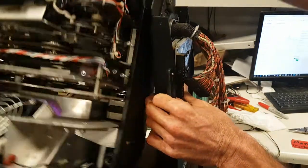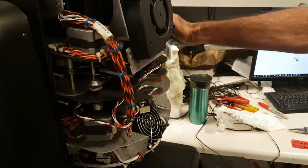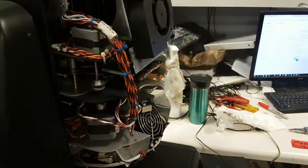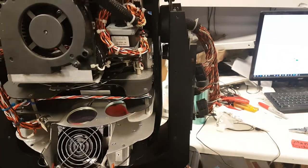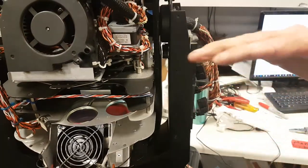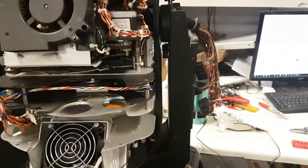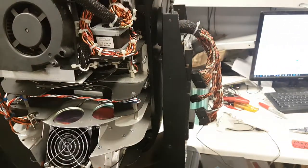So there you go — we just cleaned up the stabilizer and now it doesn't make any squeaky sound like it used to. It also helps on the tilt belt and motor; when this is clean it doesn't have to work too hard to move the head, so you don't hear that sound when the stepper motor is skipping. Thanks for watching, subscribe to the channel, check out the Facebook page, and see you guys later!